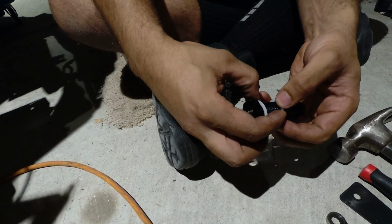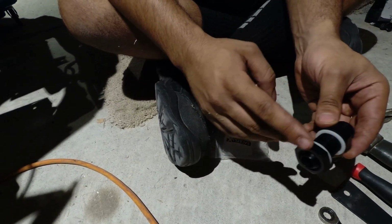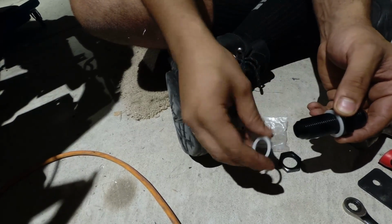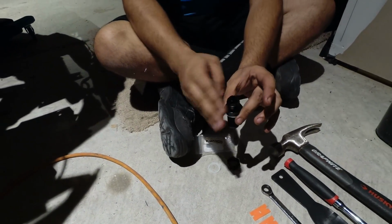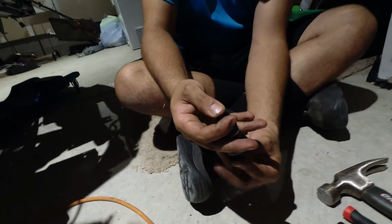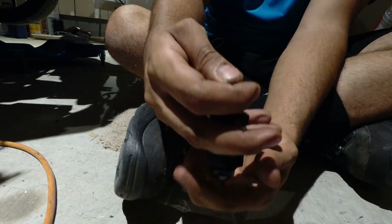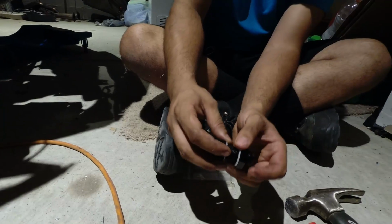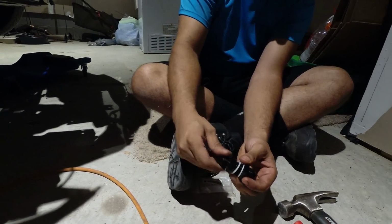The way this is going to work is your oil sump, once you've taken the pan off, is going to be drilled, and you're going to take this nut off as well as this washer. You're going to put this on top, so this is going to be sitting on top. Your sump is going to be right here, and it's going to be sandwiched with these nut and washer, like this. Okay? This needs to be tightened on, and I would recommend using some RTV on it as well to seal any irregular mating surfaces here so that you don't leak anything.